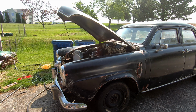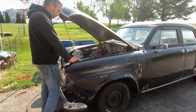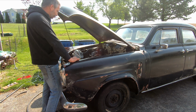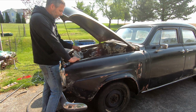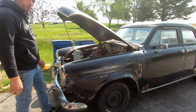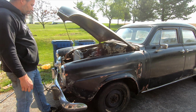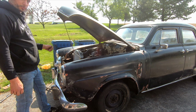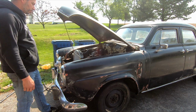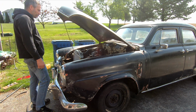Okay, I think it's recording now. All right, I've got what's probably way too tight of a throttle return spring on there, but at least it will keep it at low idle. There is fuel in the bowl. The squirter works really good now. I mean, it should, it's a rebuilt carburetor, but that gives me hope that it should work. I've probably hit it more times than I needed just from sitting here.